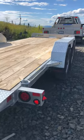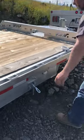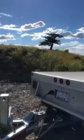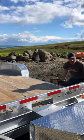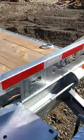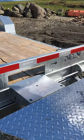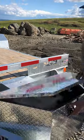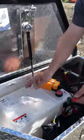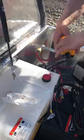We'll show you how quick and easy the tilt is. To tilt your box, it comes factory with a winch plate — you can install whatever winch you need for your equipment. Back here you've got your power switch, hydraulic tank, hydraulic remote, and battery. Turn the power on, make sure the valve is down, and you go up.